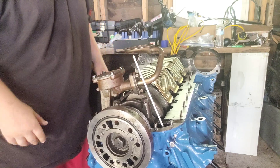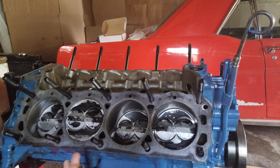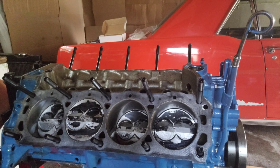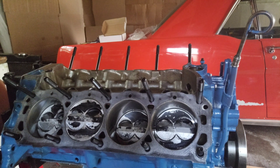Check out these pistons. I know I didn't get the pistons fully cleaned, but they're clean enough for our purposes. The only thing that's going to affect is the looks, and frankly you're not going to be able to see it inside the motor. Things to note: the notch of the pistons is towards the back of the block, which means we swapped them bank to bank, reversing the piston offset.